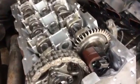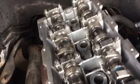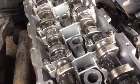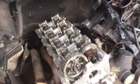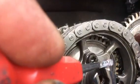Again, I had all that on a piece of paper, just on one side, just to make sure I did get the right order of the big bolts. The big bolts on the head, they're stretch bolts as well. Chuck them and get some new ones. I know you can measure them for tolerances, but I would rather spend a tiny bit of money on something that's right at the heart of the job and not worry about it.